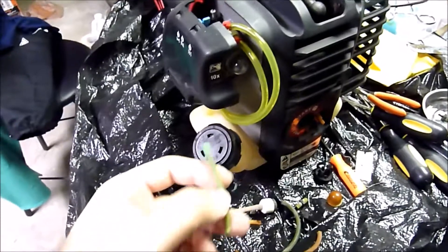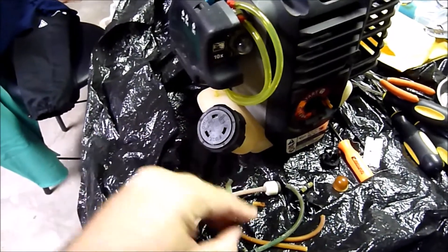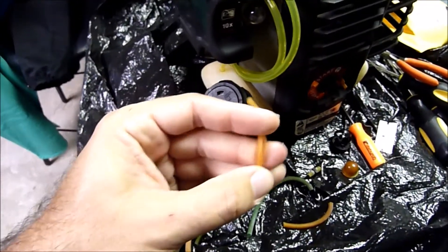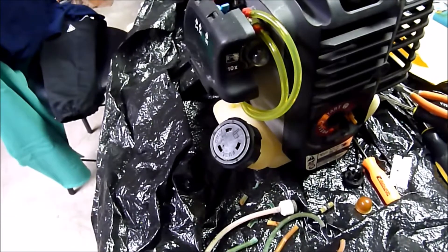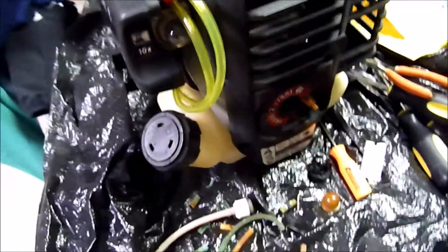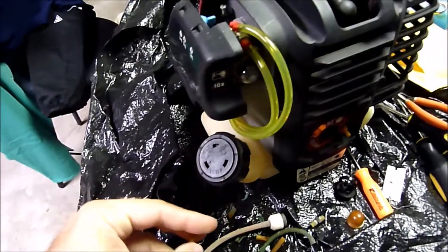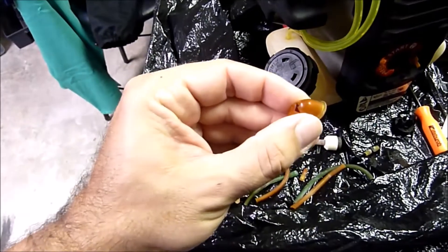I just did a rebuild on this weed whacker, and this is showing these lines with only a couple years of exposure to ethanol. You can see it just splits wide open, right like that — so you can imagine this in your aircraft. This particular weed whacker did not have too much runtime on it, but it did have years of exposure to the fuel. It's a four-cycle weed whacker, so you're not seeing anything due to an oil-fuel mix. Looking at all these little bits and pieces that came out — even the fuel primer bulb right here is all shattered.